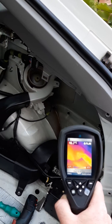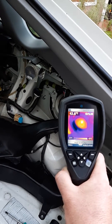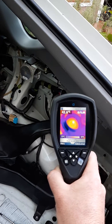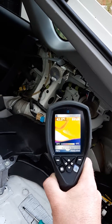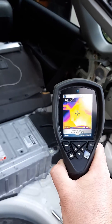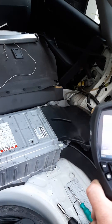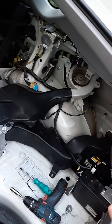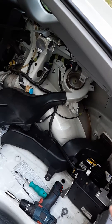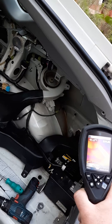So what we can say here is that the fan is definitely working. It's turning and it's not seized. About two weeks ago I'd cleaned it — it was full of lint and dirt — so I'm happy to say that it's actually working and it's extracting heat, just by looking at the temperature differential. Calculating there, the top duct is 36 degrees and the exhaust duct is about 45, 48, 46 degrees. So you're looking at a delta T of 10 degrees. Delta T of 10 degrees — it's extracting.